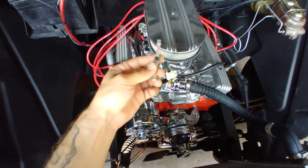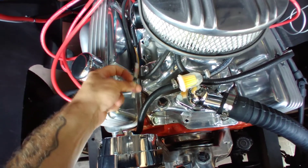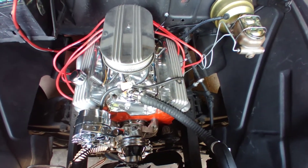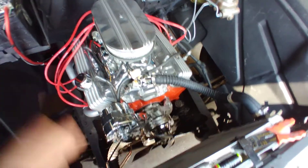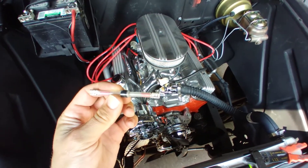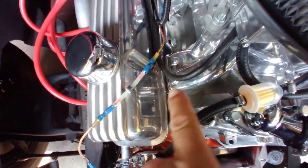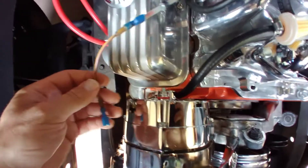What I'm going to do is wire this diode into this wire here — it hooks on here and the other side comes out and plugs into the alternator. This keeps anything from back-feeding back to the distributor, and you can still run everything off that one wire going to your ignition. I'll put a link to this diode in the description. Here's my diode all wired up — flow goes this direction and it can't go back.